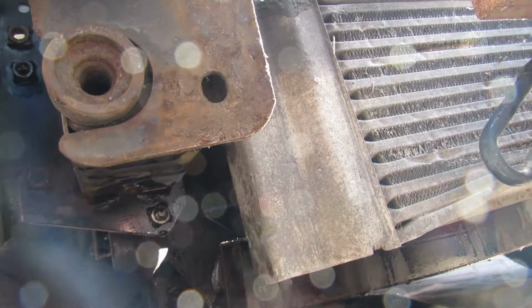So in order to get the pump off, it looks like we've got a load of Torx bolts, small ones and big ones. We've got to take this pipe off here, the one that runs along there. We're just going to clean all this up before trying to remove it. We're replacing this, and this has got caps over them. You can hear that now, that's gone. Eventually that'll just collapse, and that pump doesn't look great. When we take it off, sounds a bit rough, that does. You know what? This is water there, look. It's a very slow drip, but it is dripping.